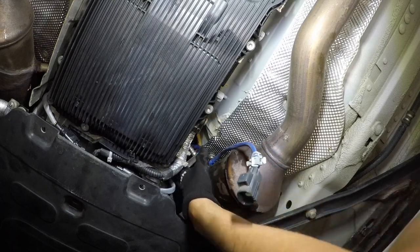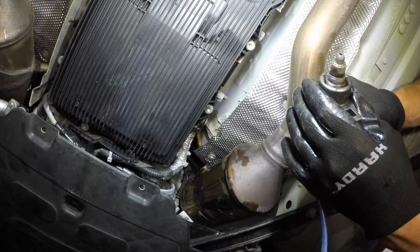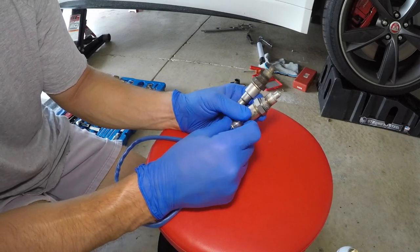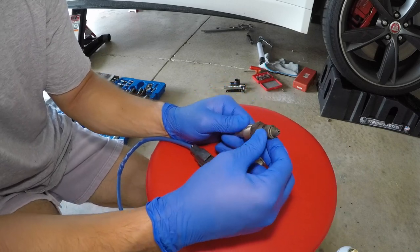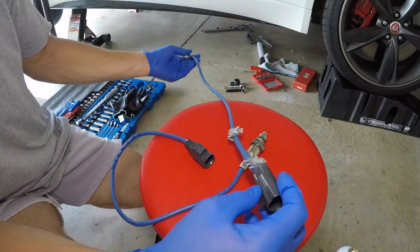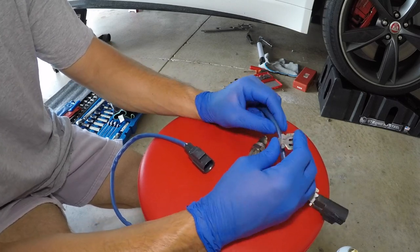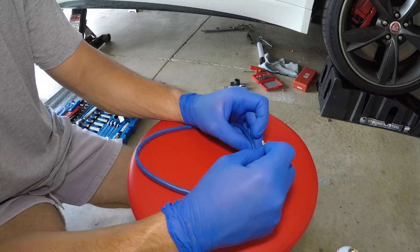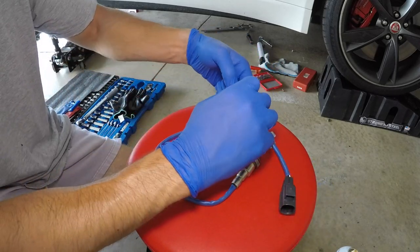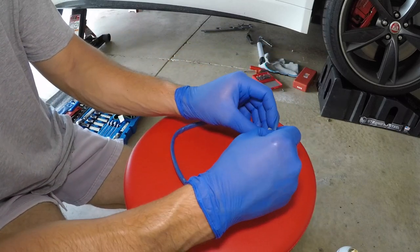I was a little haphazard here because the wire is dead and the whole sensor's dead, so I don't really care how I remove it. Here is a new versus old comparison. Something cool is that the new one already has Teflon tape on it ready to get a good seal. The old one looks like it was just thrown in a fire — very charred. Now remove the clips, making sure to orientate them so you can transfer them onto the new O2 sensor easily. Orientate them the same way you took them off so you don't run into any issues putting them back on. They just slide on.